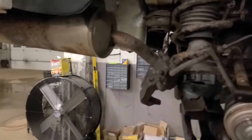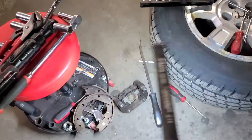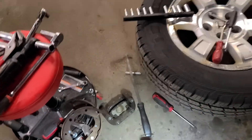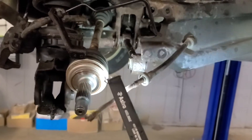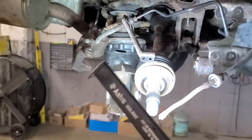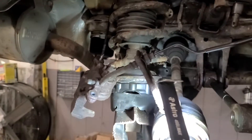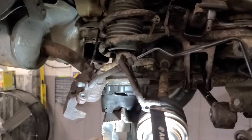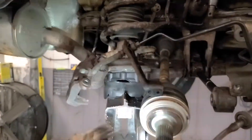First you're going to pull your brake caliper, get that off, and hang it up out of the way. Then take off your caliper bracket with your pads and stuff. Then knock your rotor off. Then get your e-brake hardware all out of the way and unhook your e-brake line so you can take the hub out. Unhook the brake hardware from where it's bolted in the back — it's two 10mm bolts. Get your speed sensor out; mine wouldn't come out so I had to cut it out and popped it out later.